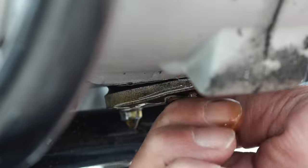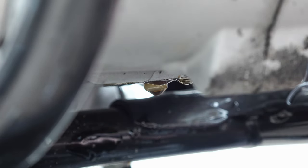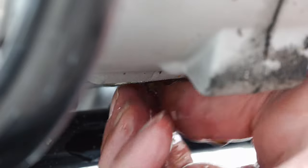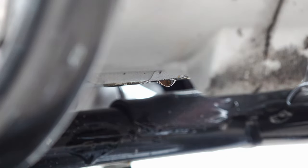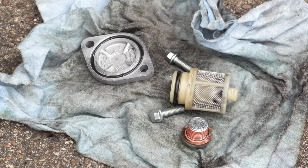You can then go ahead and remove the strainer cover and the strainer itself. The strainer is basically made of plastic with metal mesh — it's an interference fit held in place by a rubber O-ring. Royal Enfield recommend using round-nose pliers to remove it, but I don't like that idea. With the housing being plastic, it's very easy to cause damage. You can just remove it with your fingers — it's not easy, but there's zero chance of causing damage. The strainer itself was actually pretty clean with no debris visible, but all these parts require thorough cleaning before refitting.